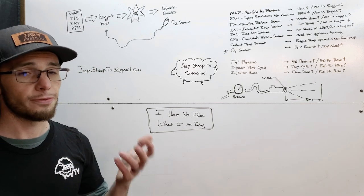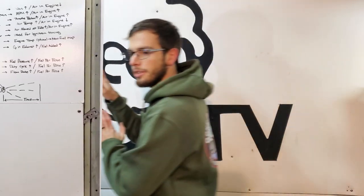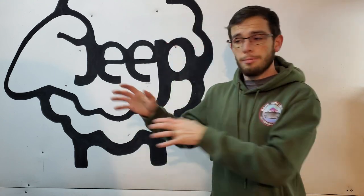Quick update: I've been messaging with Grayson, who has the supercharger installed and is using the split second enricher for fuel tuning. He says it's working great. However, at 50% and above throttle at 3,000 RPM — pretty much what you're doing on the highway — it's going into open loop mode, which means you're not using your O2 sensor. The enricher looks at the O2 sensor, and now that loop is not being used, so he's having some issues and may need a power commander or different tuning device. Keep that in mind: it works great in closed loop, but your Jeep is not always in closed loop mode and it will have no effect when it's in open loop mode.